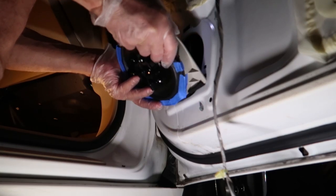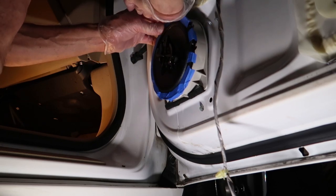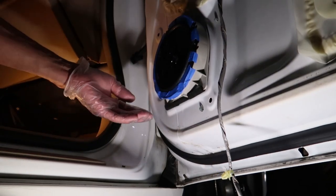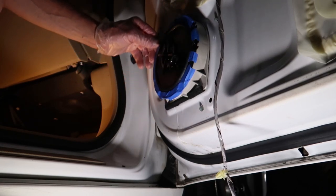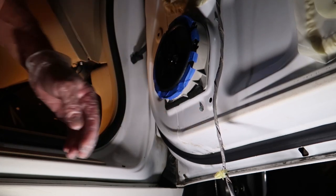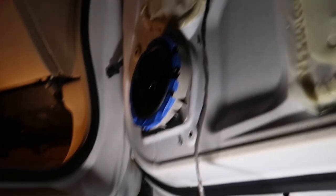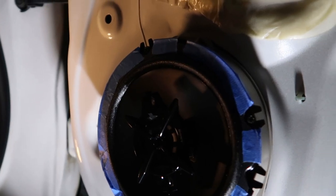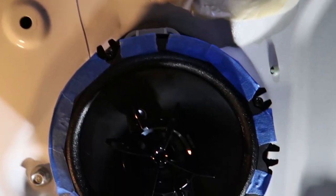Now that the wiring is complete, it's time to slide these two tabs into the bottom of the door and then pop the top clip back in — give it a few taps and boom, it popped right back in. That is a nice tight fitment, just like factory. I would definitely recommend getting some proper foam tape to go around the perimeter of this speaker, but you won't be able to see the tape once you put the door panel over it. The fitment is great — it's just like factory. There won't be any rattling around, and the sound quality will be vastly improved with this aftermarket speaker.